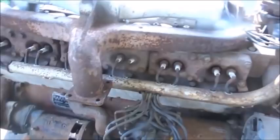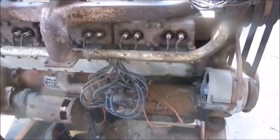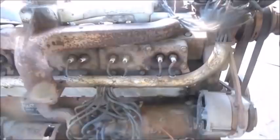So you've got one spark plug per cylinder per distributor. We really just need to get one distributor and get it firing — one set of the plugs — and get them cleaned up. The secondary we won't worry about right now. We just want to get one side running. I can probably run it with one coil and one set of points. We'll see how that works out.